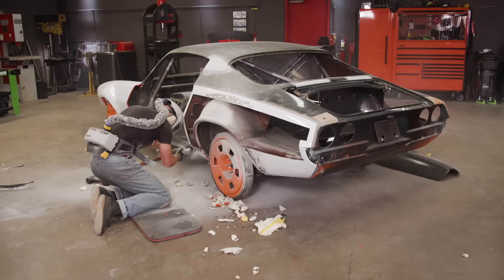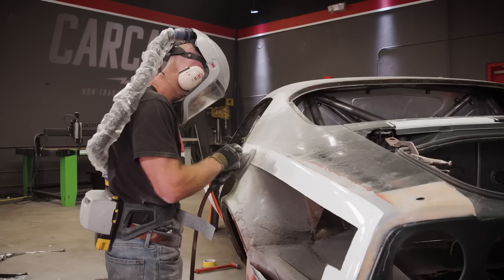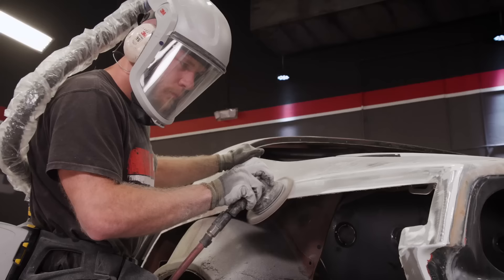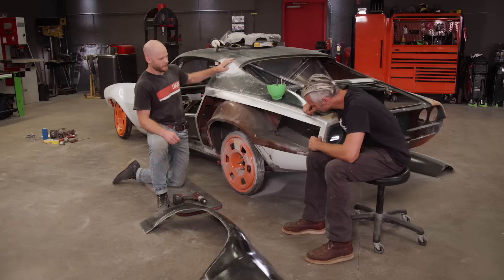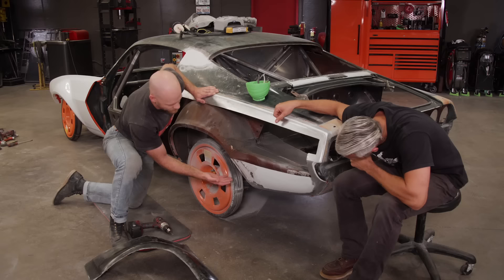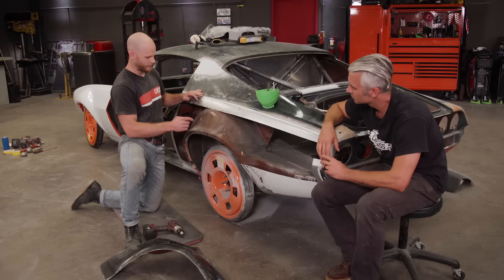I'm going to start removing the paint on the edges so I can get a really clear view of what I'm working with. Got this rear quarter panel cut out now and I've got this kind of trimmed out, got these sharp edges taken care of. I'm probably going to end up coming back and cutting this way down, possibly cutting this entire lower section off and bracing it from the chassis to our new quarter. Also, with our wide tires, if I left this inner fender lip, it would end up cutting our tires, so at some point we're going to come back and cut this entire section out.